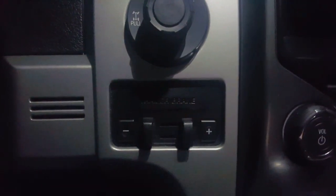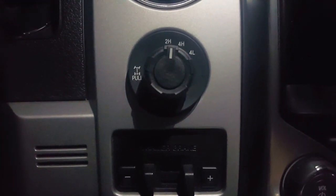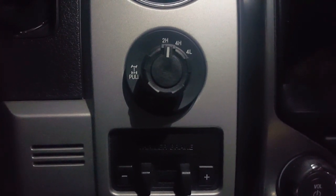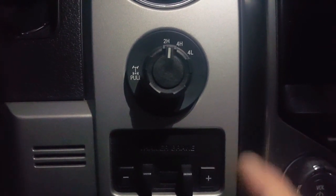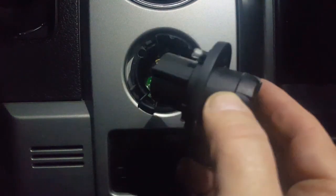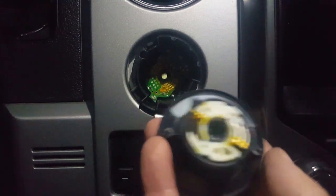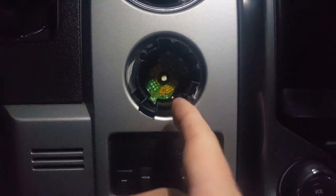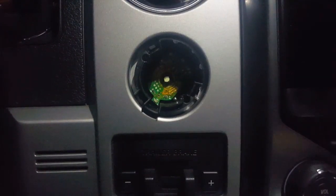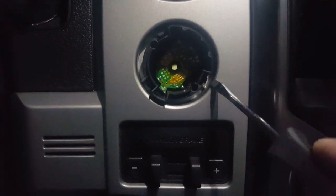I can reach the connector in the back of the switch, but I can't undo the connector and I can't reach the tabs. The easiest way for me to do it is I take and I broke off the end of this switch. You can see it was held on here and held on here, and that's the only thing holding this face in that switch assembly. So once I broke it off, it gave me the availability of the three tabs.